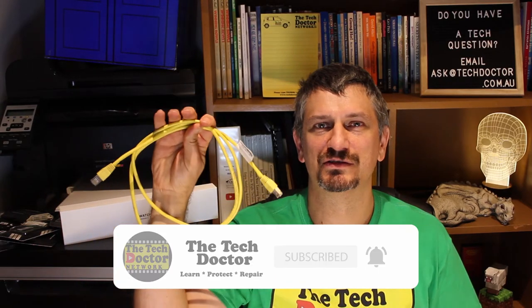In this case I'm talking about a wired connection between the main router and the new router — something like one of these but probably longer. You can run a cable like this yourself or get a friend or electrician to run one for you. It's just a standard piece of Cat 5 or 6 cable that you can buy anywhere. This is a bit of a weird-looking router from D-Link that somebody gave me after cleaning out their tech box. A glance at the bottom gives me the model number so I can look up the specifications, and it also gives the link, username and password for the configuration page, which we'll need later.